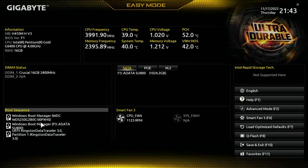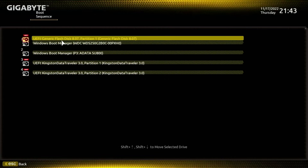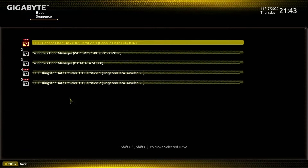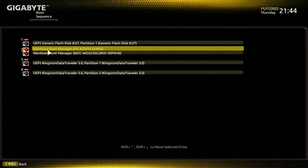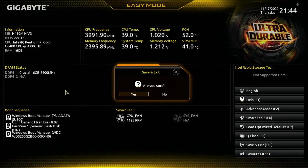Now that we know all the drives connected to our system are visible, we just need to configure it properly so we're able to boot off our drive. If you have access to easy mode, the quickest way is to go into your boot sequence here, find the drive that has Windows on it — more often than not it will say Windows Boot Manager. For instance, if we want the ADATA SU800 Windows Boot Manager to load Windows, we drag that to the top of the list, press Escape, then press F10 to save and exit, and this will boot off that drive.